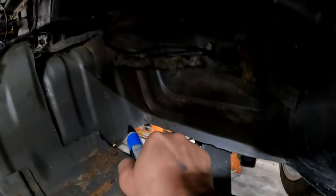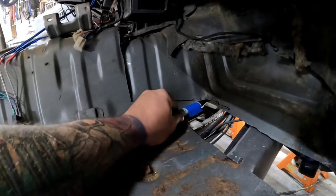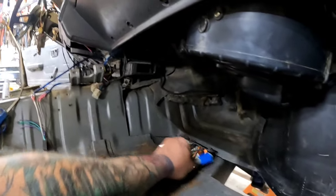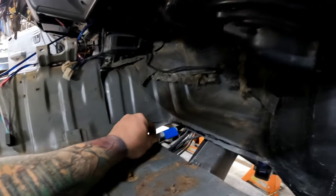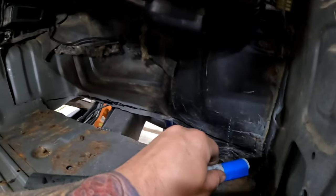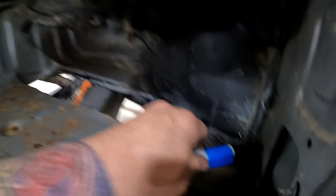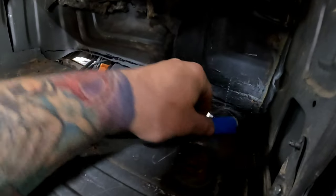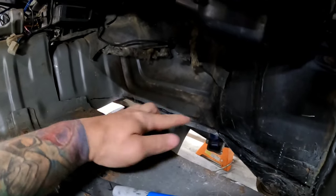Sorry, it's kind of dark in here. I need to get a light set up, but this would be roughly where my line would need to be. There's little ridges in the floor, so the line changes a little bit. I'm just gonna basically pick a line from there and go up. But same thing for in the corner. This edge. So now that that's marked out, sort of, kind of, I'm just gonna go through and cut that line, and that way I can make my template.